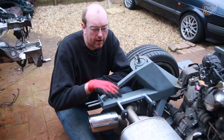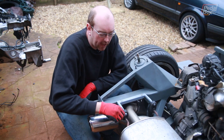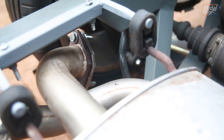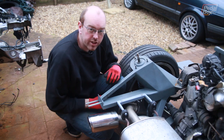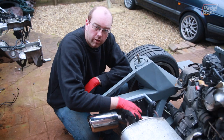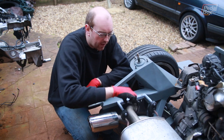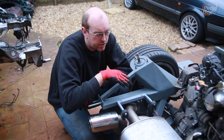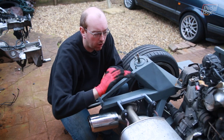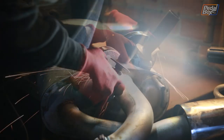We put the back box back in on its hangers and it's sitting a little bit forward — tipped at the moment. We might want longer hangers later to lower it down, but right now we need to deal with the inlet. The inlet into the back box currently comes in from right underneath the arm and there's no way to route that simply all the way around into the turbo. So we're going to cut this right off at the edge of the box, shorten it down about four or five inches, re-weld it, and rotate it round to the top to give us a nice clear shot from there around back and down into the box — that should make our routing a lot easier.